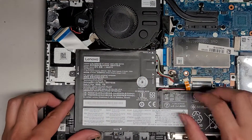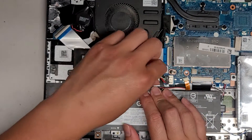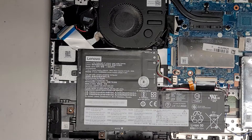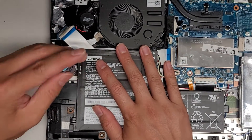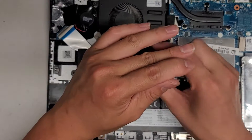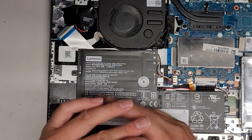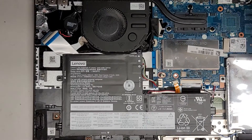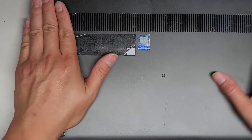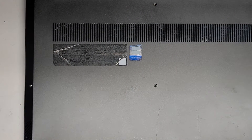Get the battery back on top. Plug this back in and make sure it's in all the way. Put the battery screws back in. Now that we've got all the screws in, let's go ahead and put this cover on. We're going to use a T5 or Torx 5 screwdriver and put those back.